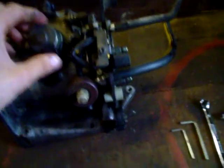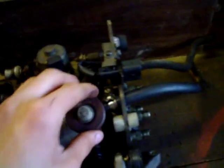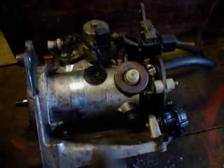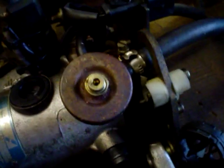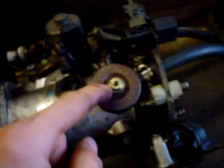Depending on what pump you've got, adjusting your fueling is done in two different ways. You've got your max fuel, which is fueling across the whole rev range, and you've got your boost compensator, which is only used when the car's on boost. The boost compensator fueling doesn't actually make a huge difference — the max fuel is what you'll notice massively. To adjust the boost compensator on the Lucas pump: get a pair of pliers, put them on top of this cap and give them left and right — it'll come off. Under here you'll see a lock bolt. Put a spanner on the lock nut around the outside, loosen that, then turn it anti-clockwise — start with one turn and increase if you need more fuel. Don't forget to tighten the lock bolt when finished, otherwise it will vibrate loose.